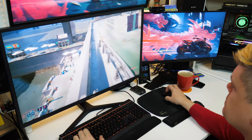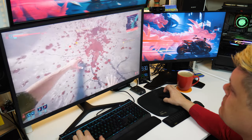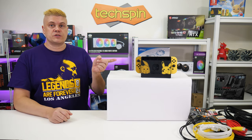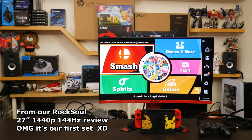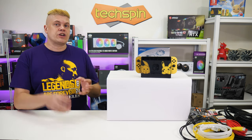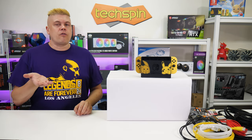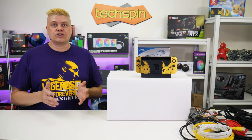If you want some future-proofing, grabbing an HDMI 2.1 cable for 8K TVs might be useful down the road if it doesn't cost a lot more. If you hook up an old graphics card, PS4 non-pro, DVD player, or Switch to a 2K 144Hz or 4K 60Hz monitor, you'll probably still see a lower-res 1080p picture even with an HDMI 1.4 cable, because the monitor is upscaling the image. However, using the same HDMI 1.4 cable and trying to push a higher 1440p 144Hz or 4K 60Hz signal, the cable will be the issue and likely not show anything at all.